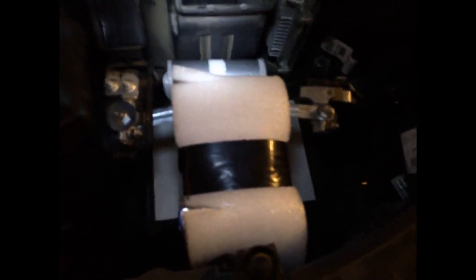I had to discharge it to work on the posts, but it looks all right. I've got some foam on top to protect the terminals, and foam in the back so it doesn't slide. There's very little chance of it coming forward because it's held in place. This is what replacing my 12-volt battery with ultra capacitors looks like.